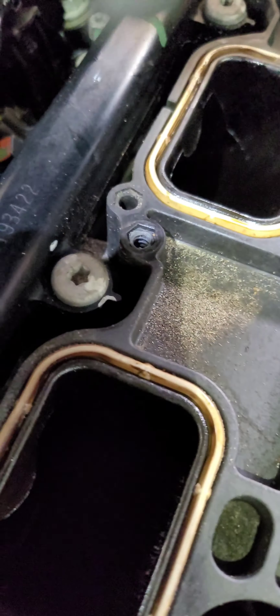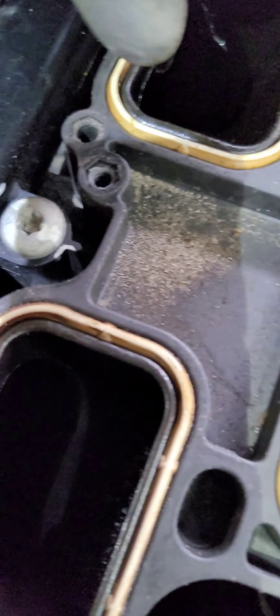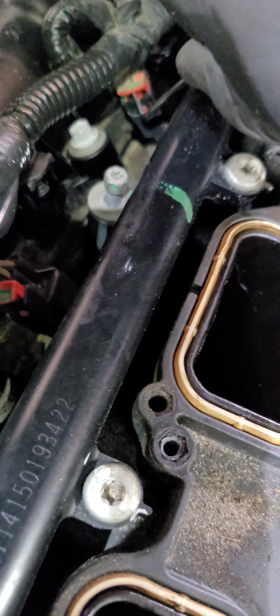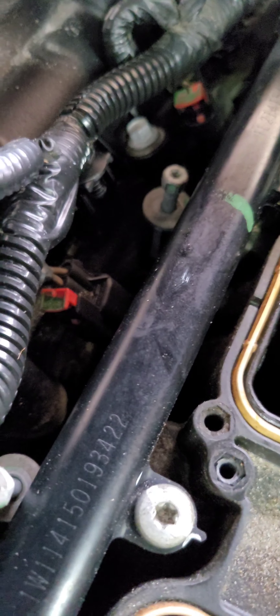If you're dealing with a 3.6 Dodge Chrysler engine, the injector clips will have locks on them. You just lift the lock with a pick — you see it pops up — and then you squeeze the plug and pull it up. That's the lock. Then you do the normal thing to remove the clip. With those six clips undone and those screws out, the lower intake manifold will come right up.